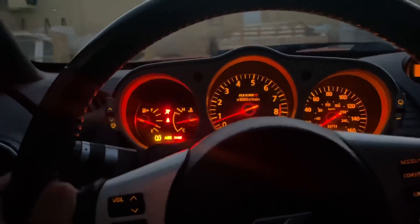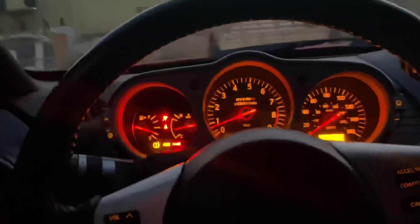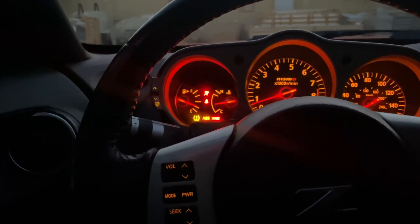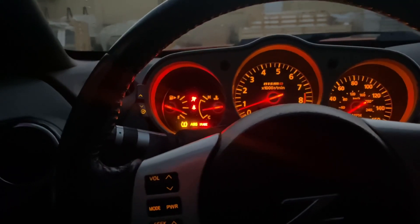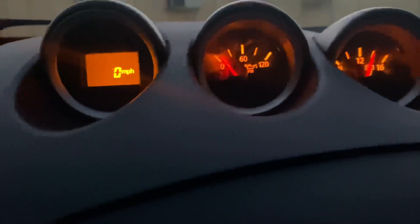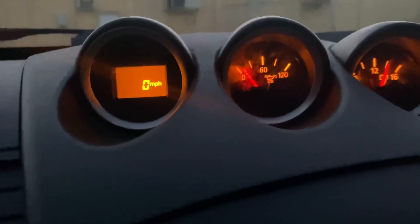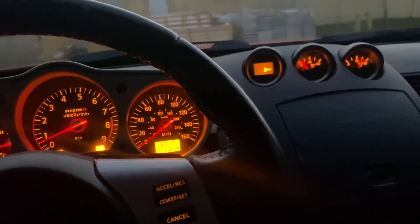This is about two days after the day I did the oil pressure sensor. I changed it, went to the car when it was warm — I thought the idle pressure was fine, it was right in the middle at 15 psi. I couldn't drive the car because I was on jack stands. So I'm pretty much gonna show you guys: oil pressure is bad, that's around 10 to 12 psi. The minimum from what I've been told is 15 psi.